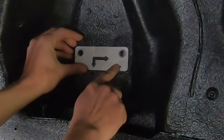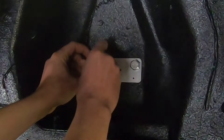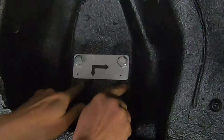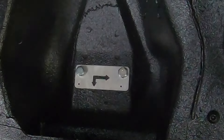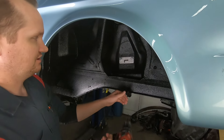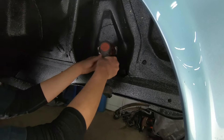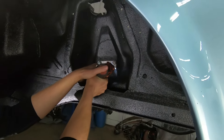What's going to happen is you're going to get a set of bolts to hold this in place from the original location. Then you have two little pilot holes that are going to go down one inch and back about an eighth of an inch. As long as you just bolt these up and then you have two little pilot holes that we're going to drill. We got those snugged up with nuts on the backside, and we're just going to drill a small little pilot hole here — eighth inch drill bit.